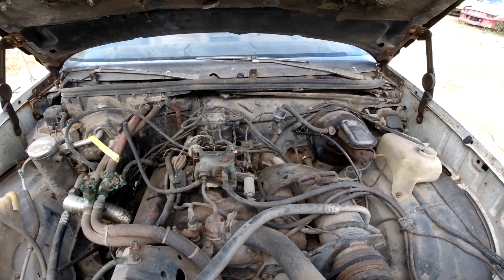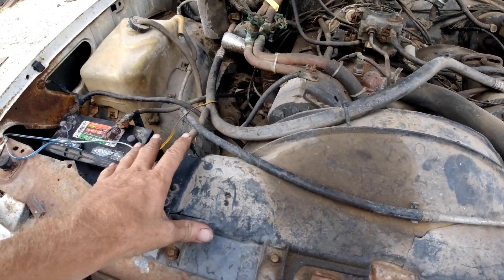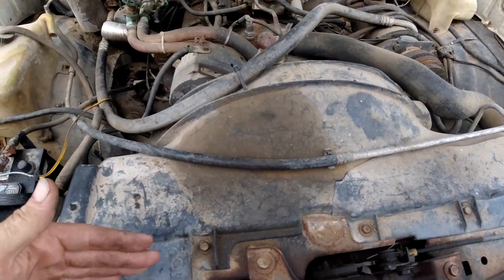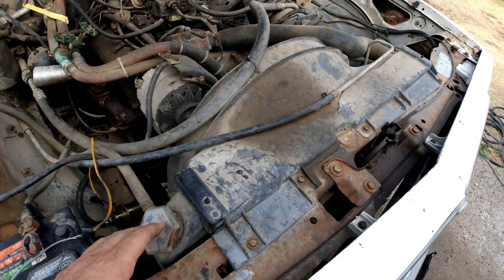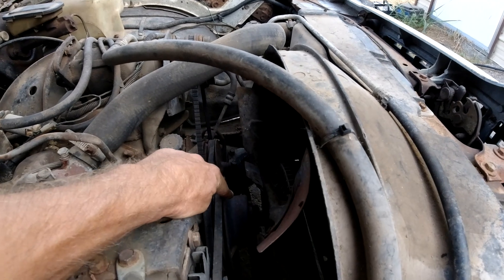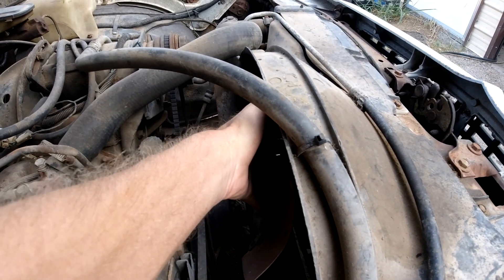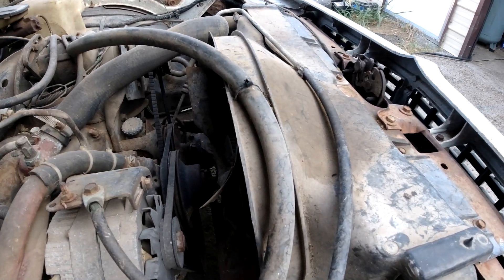At the top of the engine, we've got to take out the radiator and the shroud, and the AC condenser behind here, so we're not going to worry about that too much. We've got to take off this fan — these four bolts, take them off, push the fan, slide it out.